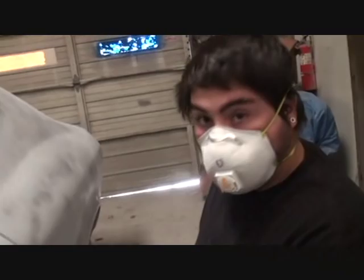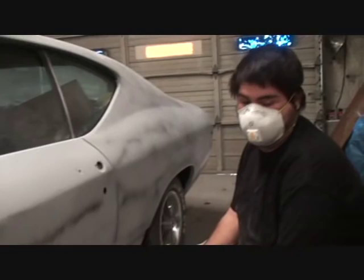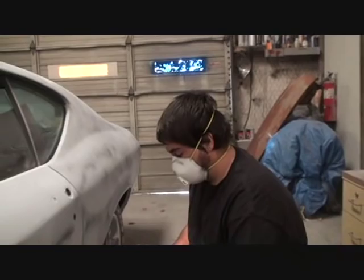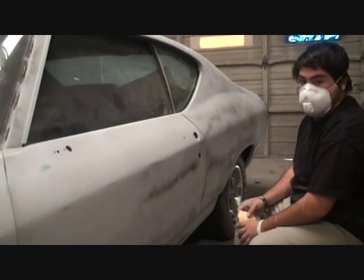What? Well, we're going to go ahead and dry sand the whole car. Okay. We're going to start out with 220 and work our way down to 320. But since I was here on Thanksgiving Day, block sanding this car out while you were eating your turkey dinner, enjoying your family atmosphere, my friend Pete decided to go ahead and what are you using on that block now? 180. Okay, we're going to block sand the whole car 180, and then we're going to come back with wet 400 because we really want this to be a nice clean job. Okay. And wet sanding is really the way to go when it comes to show car quality. You can achieve this with 320. But since the weather has turned on us for the better, that means that it's warmer out. We're going to go with wet sanding.